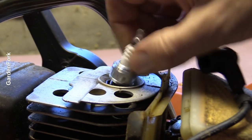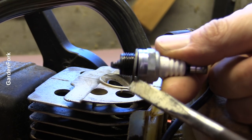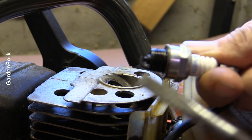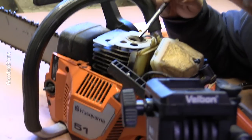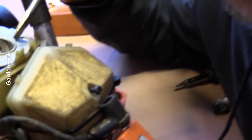This spark plug looks kind of new. Not horrible, not great. Inside here is the cylinder, and I'm gonna shine a little light in there to see if I can see any scoring or any badness.